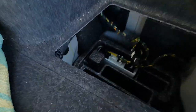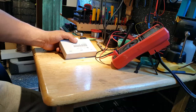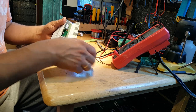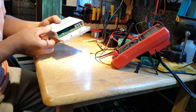We're now in the boot. The PDC module — I believe it's going to be underneath here — there it is. And look, can you see all this water? It's full of water right at the bottom. That's no good. So what I'm going to do now is take these off and take it to the bench to see what we can do.